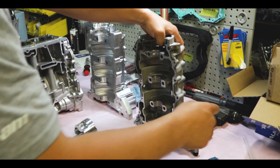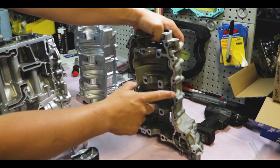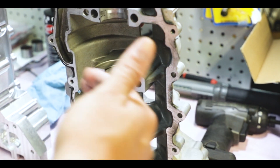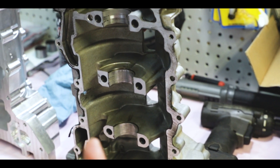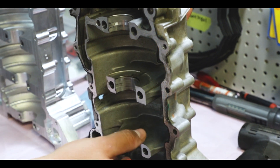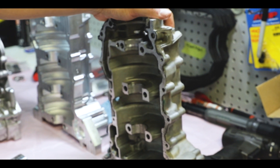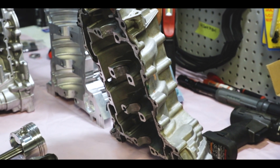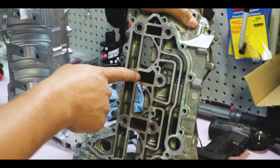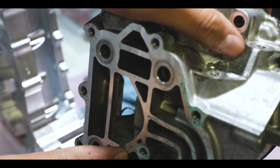We were having a lot of crazy stuff going on down there because it wasn't structurally up to par. Something interesting about the factory girdle is there's not a whole lot of strutting to keep the mains from wanting to move around. A three-cylinder engine has a lot of side loading just by the way the engine rotates and the power comes in. We were having a lot of shaking in the center bearings on our girdles at really high power. We were even running main studs. The next problem is all of these are hollow — the bearing structure right behind the bearing taking all that load, just hollow holes.